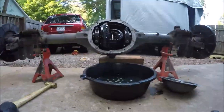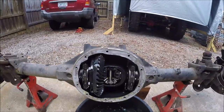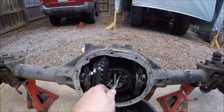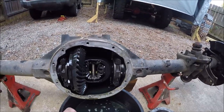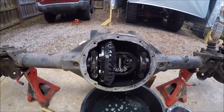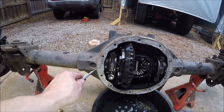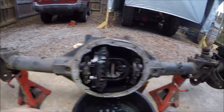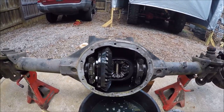Let me get up here and show you what we've got going on. So here are the innards. This is your ring gear; this is the carrier that the ring gear is mounted onto. You've got a bearing cap here and a bearing cap here — they are not interchangeable. So if you ever do a repair job or have to tear into an axle, what we usually do is mark the cap and mark the housing with a punch — an H, a T, an S, or something. Then when you pull the caps off you know they go on exactly the way they're supposed to.